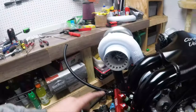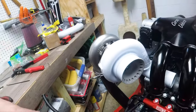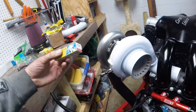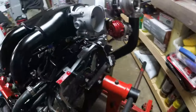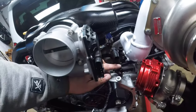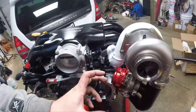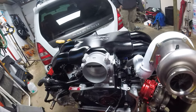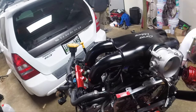There were a couple things we needed to do — like the fuel system. Spark plugs came in and we've got to run colder ones now, switching to Denso Iridium Power IK24s. We put the PCV tree back and shortened it since we no longer have the stock turbo. We finished up the throttle body with the rivets, and we also finished tuning the rally car on E85.